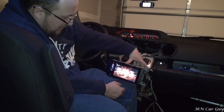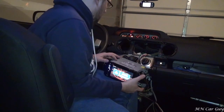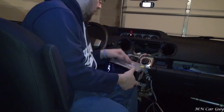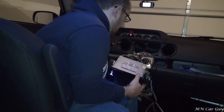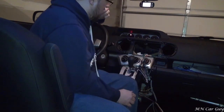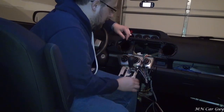Yesterday we got an error that says 'driving while watching video is not permitted — engage the emergency brake to watch video.' So the solution is to go ahead and ground this against the ground wire running into the deck, which is going to be the black wire. We've verified this works, so I'm actually going to remove it from the vehicle and go ahead and quickly solder this wire up.